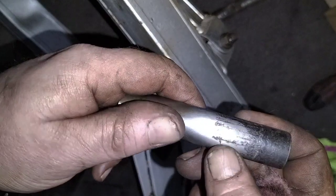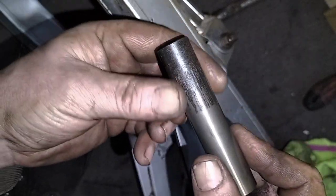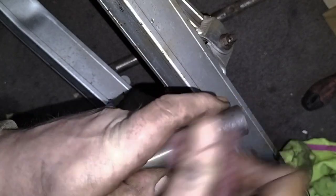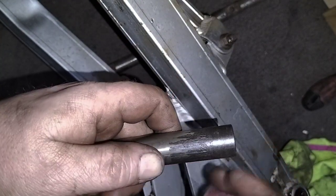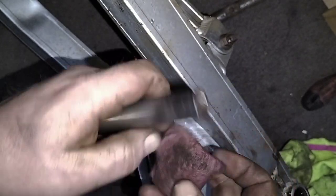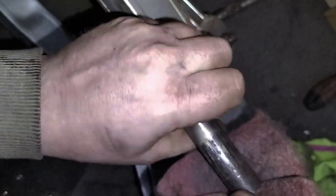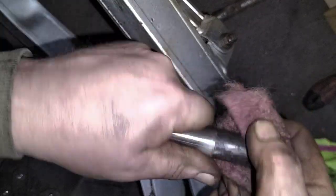It's not too pitted, there are a few marks. What I'll do is put this side in — this will be the new bearing surface, because it's a cylinder so there's nothing stopping you from turning it around and going the opposite way. It's already taken off most of the bad stuff. You want to use the least abrasive you can, especially with these older bikes — some of these parts are not obtainable anymore so you've got to try and save them. I'll get the size of the outside of the bearing and the inside, and if I have to get these bushes made up I will. But these ones are fine — I can use these again. I just have to make sure it's sealed up. There's a little grease cap that goes on the end of the bushing.